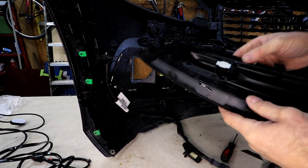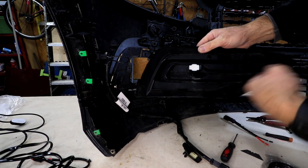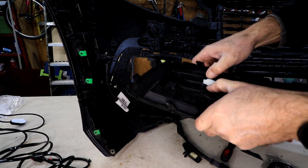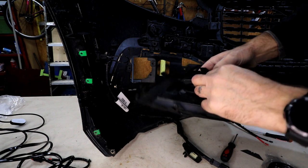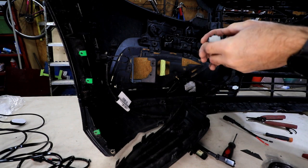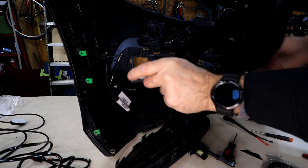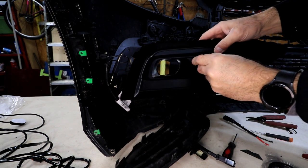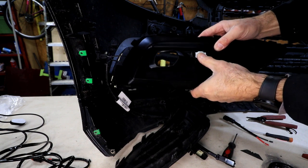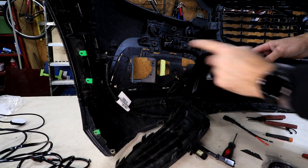These definitely didn't make easy to remove. You'll notice the sensor faces towards the center of the car — there's a little tab on the top and bottom, you just pull those apart. There it went. So it faced this way, but in the new bezel, which goes in the opposite direction, it doesn't fit the same way — it actually flips it. It pops right back in. I'm going to go around to the other side, put this in, and then we'll work on getting the fog light attached.